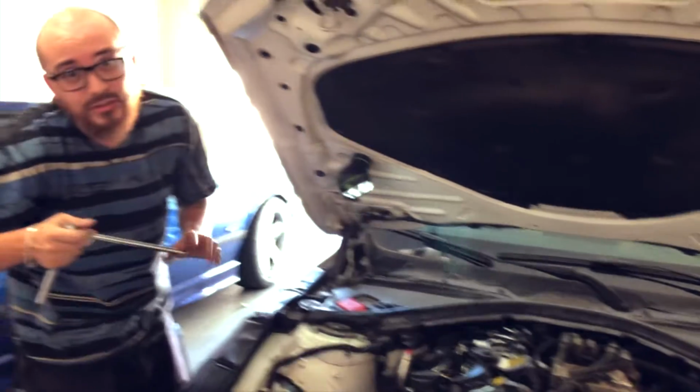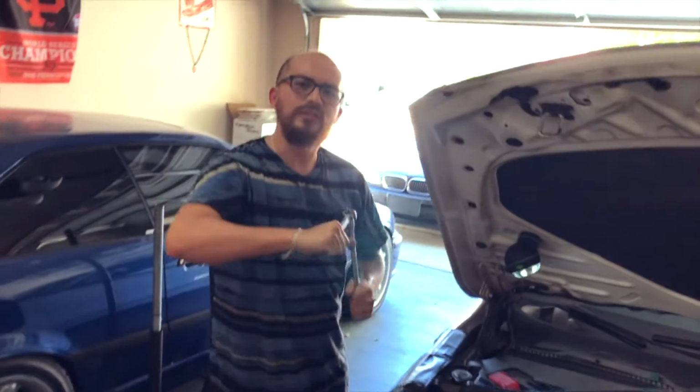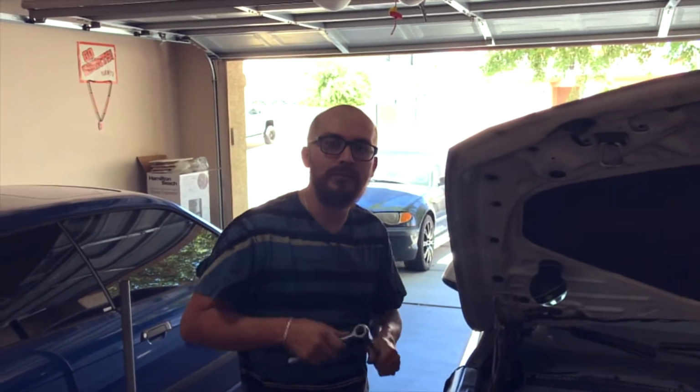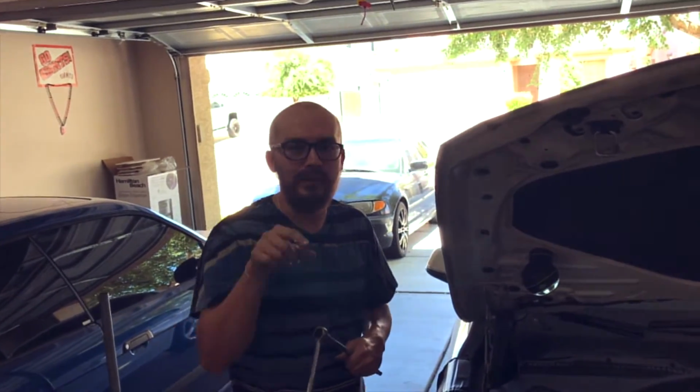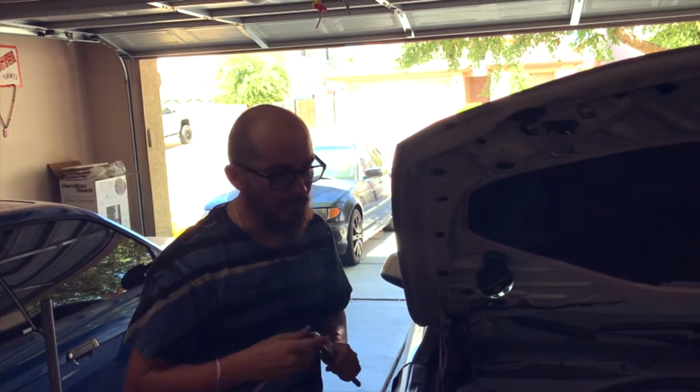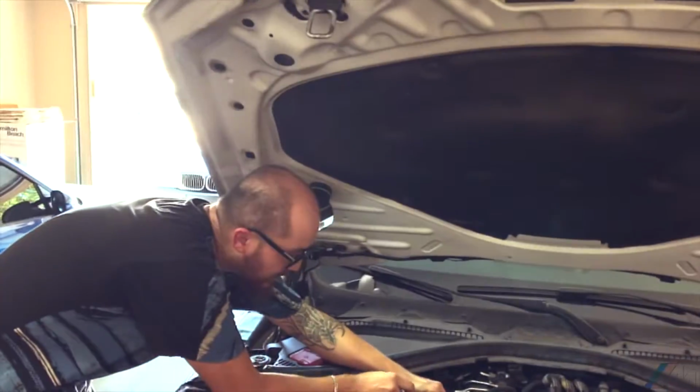So it's always practical, when you tighten it, to make sure that it's tight but not crazy tight, to the point that when you try to remove them next time, you might break them and end up with the actual spark plug inside and just the outer case. If that's the case, man, you're in some serious trouble. So let's not do that.